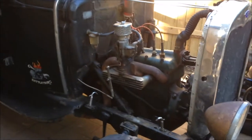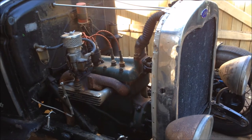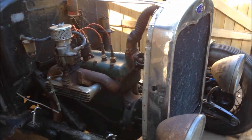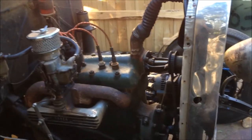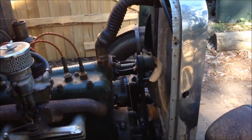I've been pretty busy over the last week. That 1928 radiator that I put in there wasn't working out for me — it was overheating and there was nothing I could do about it, so I had to put the old one back in. It's not the best radiator but it's cooling. I've flushed it out and cranked it out, so it works.